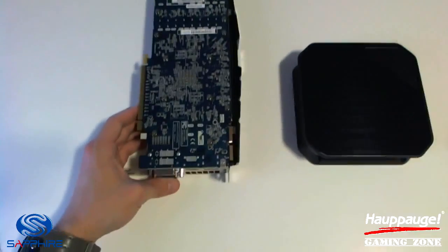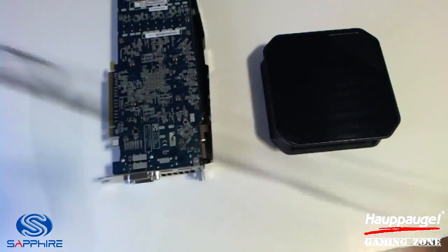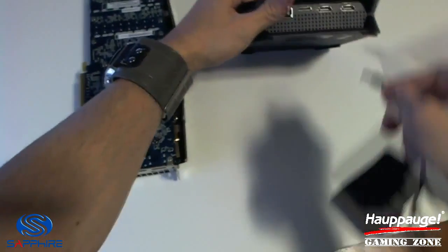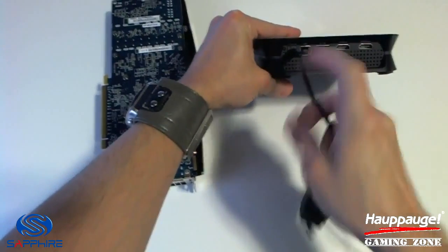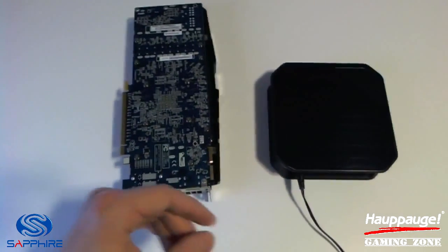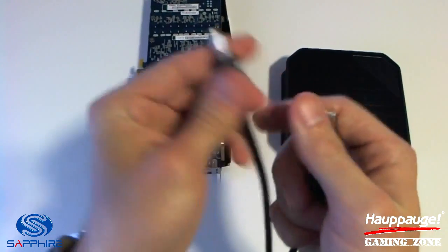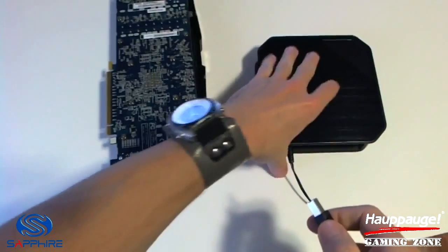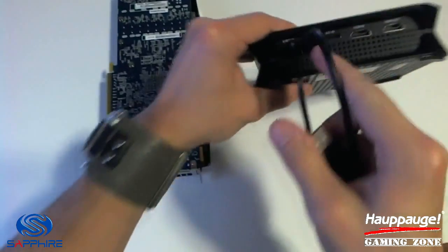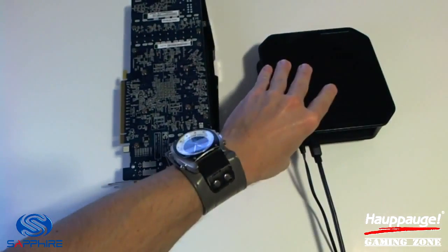Now that is going to hook into this and then bam, you have PC gameplay footage. It's really very simple guys. First, we have to hook up the HD PVR and it needs power obviously. So the first thing I always do is get my power input — not hard to find, it's on the far left. You plug it in on the wall. After that, we're going to get our USB cable because that's how it interfaces with your PC. One end is USB and the other end is the proprietary end that will go into the HD PVR. Keep in mind you should install all software that came with your HD PVR including drivers — put that on your PC first, then plug it in through USB.